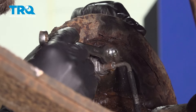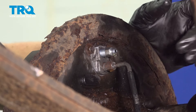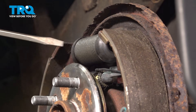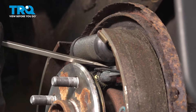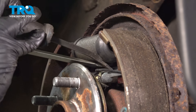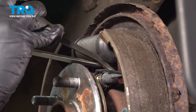You don't want to bleed these with the drum open — if you push on the brake pedal at this point with no drum on it, it will expand the shoe to the point where the wheel cylinder will literally pop open. So I'm going to put everything back together and then do a brake bleed at the end. Now let's contract the shoes back to where they were. I'm going to use a screwdriver to push on this lever here — this is the self-adjuster lever. You don't have to get it perfect; they will self-adjust, but you should get them as close as you can. If you counted the threads when you started, that would be best.